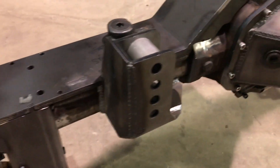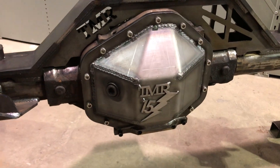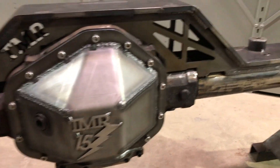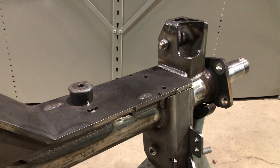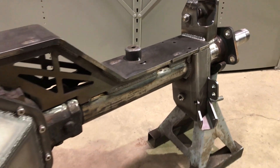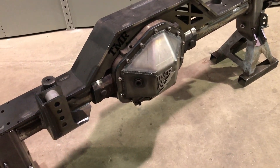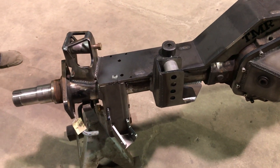Other highlights include a 10.5-inch ring gear. It's a full floater. An easy way to identify it is 14 bolts on the diff cover and 6 bolts with a removable pinion. You're probably looking at this and wondering why we've got 15 bolts on that diff cover — it's got one of our shave kits installed. If you're putting one of these in a Jeep, you might want to consider one of those kits. It saves you an inch and three-quarter of ground clearance, basically equivalent of running a 44-inch tire over a 40-inch tire.